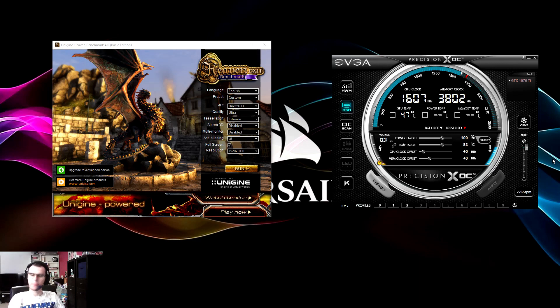First thing is ramp up your fan speed to full — this is going to keep your graphics card cool and stop it from overheating. Next, put your power target all the way up and your voltage limit all the way up. These aren't going to really hurt your GPU. The only time it will hurt is if it's throttling. Whenever you're doing a benchmark, always have your power limit on. If it's at 0 you are fine; if it reaches 1, bring down your overclock. If it stays at 1, you're basically going to cause the GPU to overheat and you could pop the processor or any MOSFETs on there. Just downclock it if you're reaching 1 until you get a stable clock.